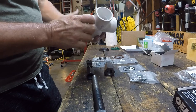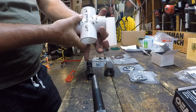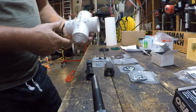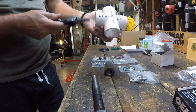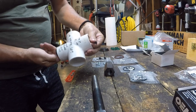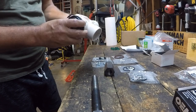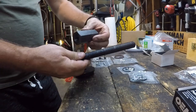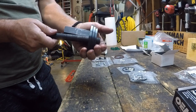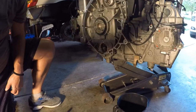This is my official IMS removal tool. It's a 2-inch piece of PVC — just a T fitting. I found this actually fits right into the IMS compartment and will sit on the actual IMS shaft, with the bearing sliding between there. I have the puller from the kit that happens to have the right thread pattern to screw into the back of the AutoZone puller. With a flat piece from the Harbor Freight kit and a couple washers, I can tighten this down and pull the bearing straight out. The T-fitting lets me stick my finger in to hold the puller from spinning while I thread everything in.